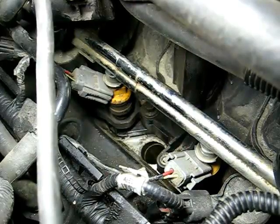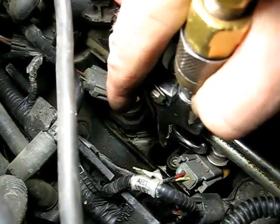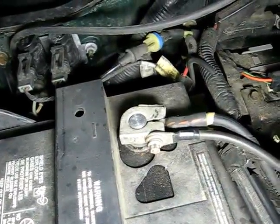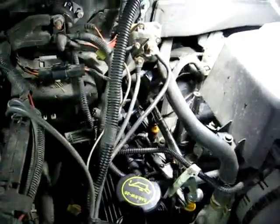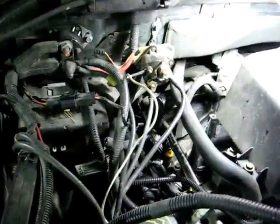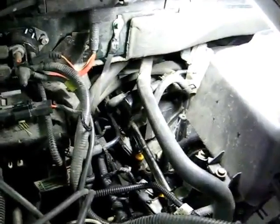The first thing we're going to do is take a little compressed air and blow it down in there to make sure we don't have any debris around the hole. Before you start putting that insert in, I would recommend removing the negative battery cable. This cylinder is the second one back on the passenger side, so to gain a little more access, we're going to move this loom wire out of the way and remove this solenoid from the firewall — it's held on by one 7mm headed bolt. That will give us a little bit more room.